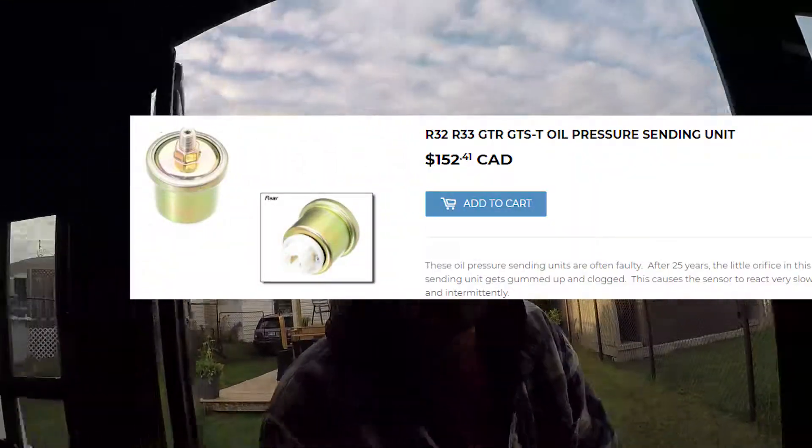I don't have another oil pressure unit, and they go for over a hundred dollars — it's not like on a Prelude where I can order one for $15. So before spending around $150 on an oil sending unit, I have a cheap mechanical oil pressure gauge I'll be plugging into that hole. It doesn't need power — it's mechanically controlled. I'll start it up, take it for a spin, and see if I'm getting proper PSI on the mechanical gauge. This could mean one of two things: I need a new oil sending unit, or...